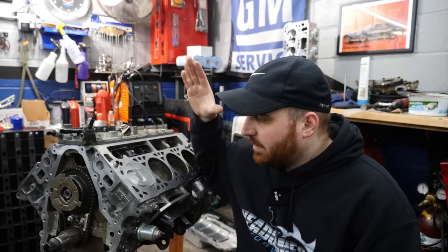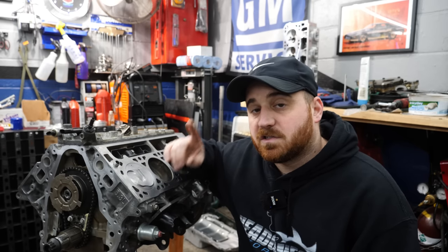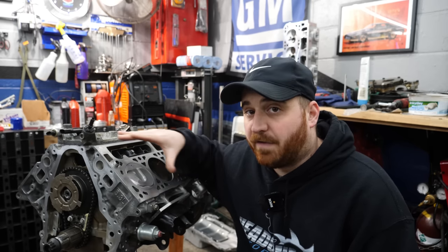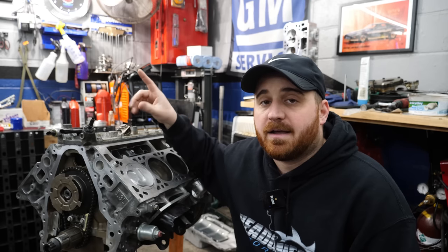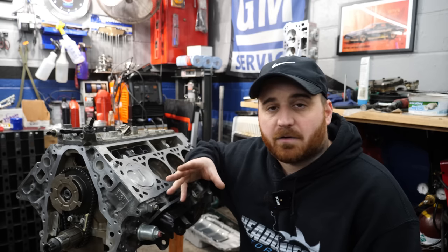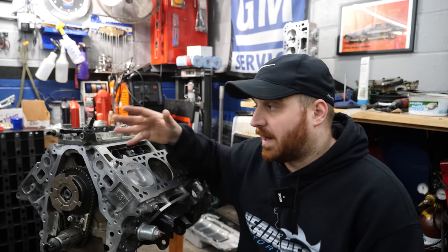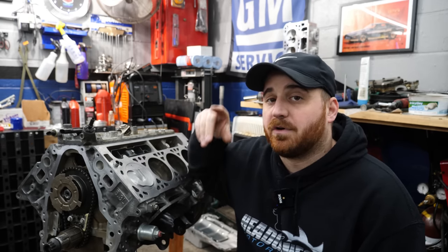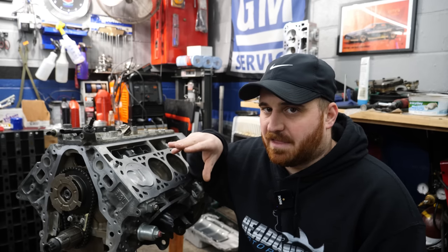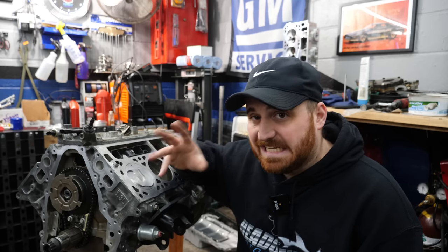Now, after speaking to the tech at Comp Cams, because this does have a Comp Cam in it with a custom Tune Time Performance profile, so it's Tune Time's grind, Comp Cams just cut the cam for them. After speaking to Comp Cams, the tech recommended 60 thou of PTV, and after speaking with Tune Time, whose grind this is, their engine builder recommended at least 70 thou. So in the last video, I measured a whopping 16 thou.